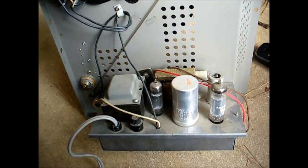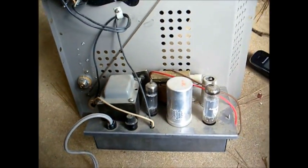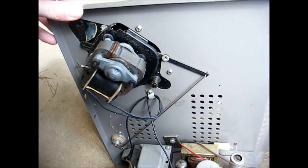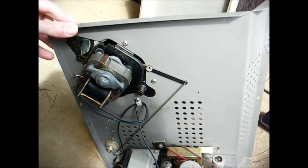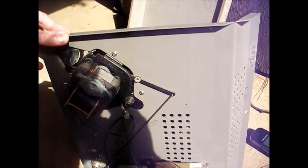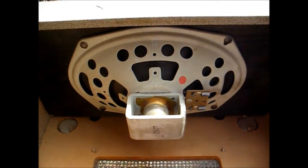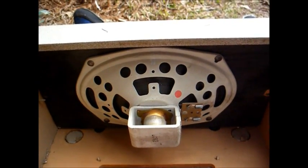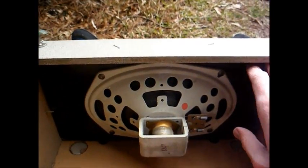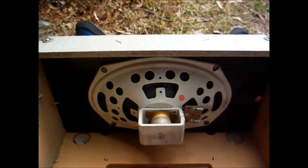Here's the nice tube amplifier that uses a 6BQ5 output tube — it's even fuse-protected. And unlike the Crosley with its cheap belt-driven turntable, this uses an idler wheel-driven turntable. I've fixed many of these school record players; usually all they need is cleaning, lubrication, and maybe a new idler wheel, and they're good to go for another 50 years. This is a 1964 model. Here's the speaker — a nice 6x9 mounted on a spring-loaded soundboard to help prevent feedback from the speaker to the cartridge and improve bass response.